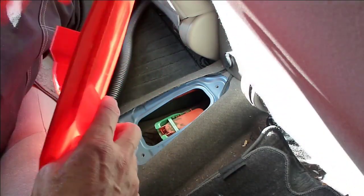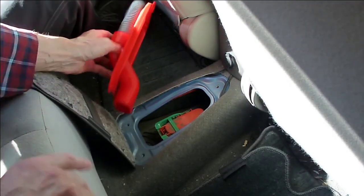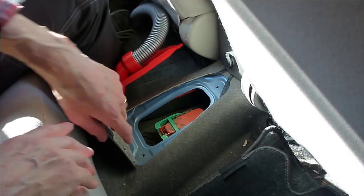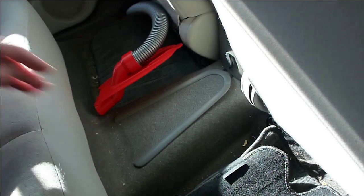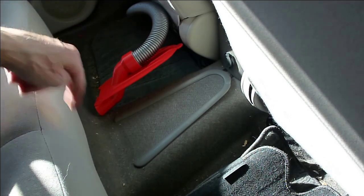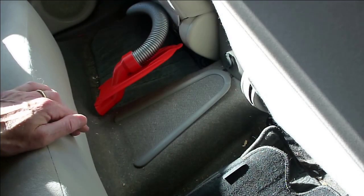This is designed so that the air goes through there and then gets funneled backwards towards the back of the battery. In a Leaf, where I'm sitting right now on the rear seat, there's a stack of 16 cells all along like a bookshelf, and those are the ones that get the hottest typically when you're fast charging. The others are spread out a bit more and can dissipate their heat more easily. This is like a big chunk in one solid block, and there's a temperature sensor right in the middle of these 16 cells — that's the one I'm going to be measuring.